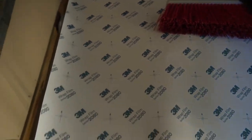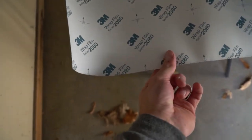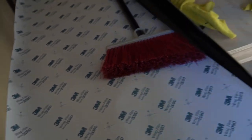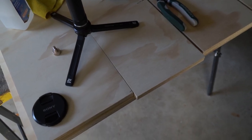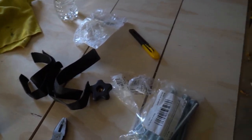The first step, when you're vinyl wrapping, is you've gotta cut a piece of vinyl, obviously. And so what I'm gonna do is cut a pretty healthy piece, probably about 6 inches wide or so, because some is gonna tuck over and under it. Just as a disclaimer, I'm not wrapping the whole entire rail. I'm just wrapping the part that you can see from the ground. It's just purely aesthetic, so I'm not gonna go too overkill with it. So let's cut that piece.